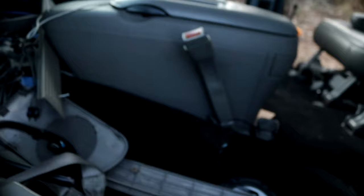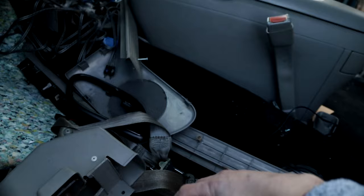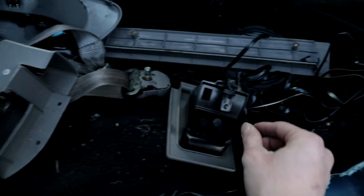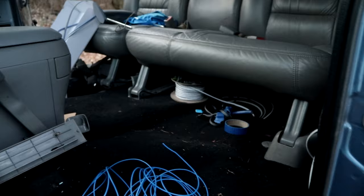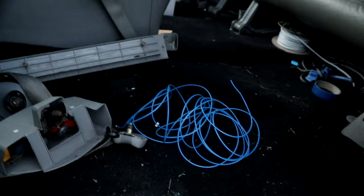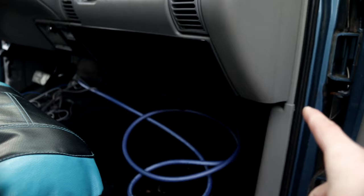The last thing to mount under the carpet is our remote bass control knob. I really don't want to have it anywhere visible. Here's the ashtray — not going to be used for smoking anymore. What we're going to do is take this bass control knob and mount it straight in there so I can pull this down and control it when I need. Going to throw the hole in the back so the wire will go through and plug up, then we'll just double-side tape it down. And before you button up all your wiring, make sure you run your remote turn-on wire as well so your amps turn on when you turn the radio on.